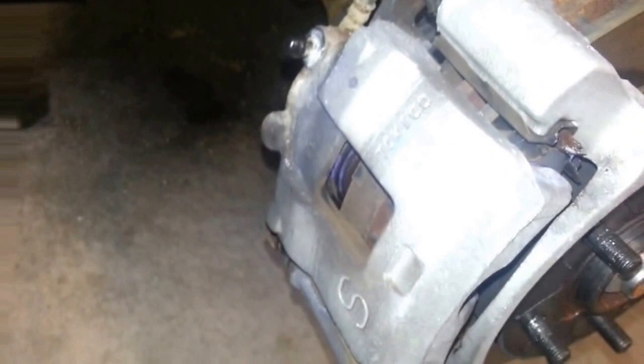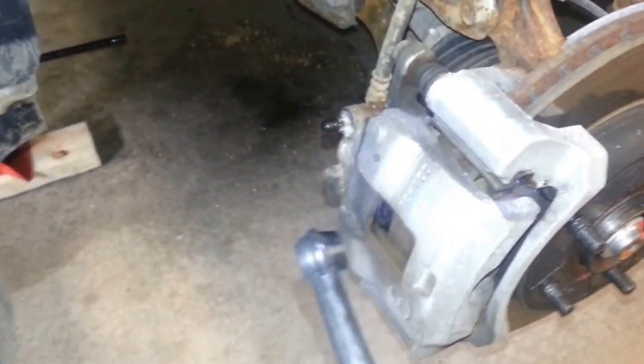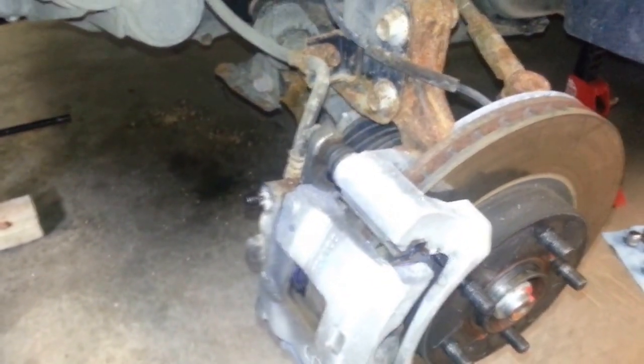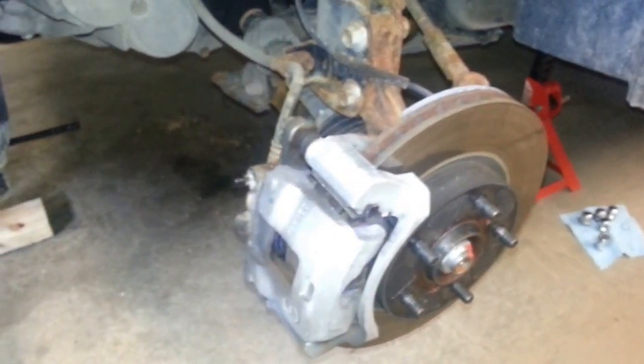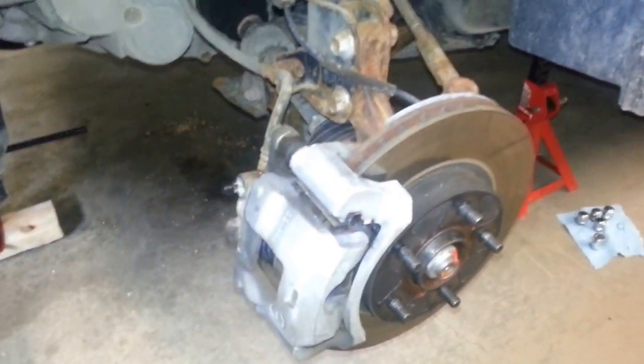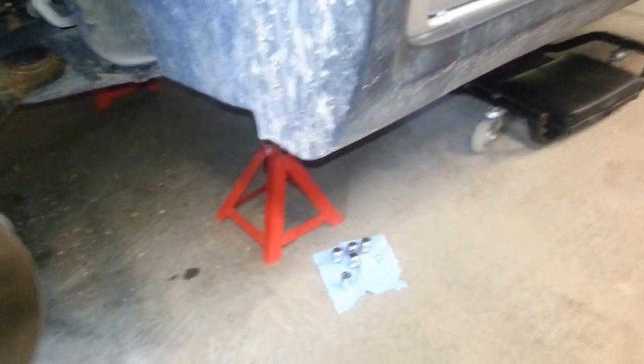Okay, so brake fluid flush is done and clutch fluid flush is done. Like I mentioned, I'd show it when bleeding the system, but I didn't show that. I'm trying to get this done here. However, I'm using a pressure bleeder. So basically it's just hooking it up, loosening the fitting, and bleeding the system. There are lots of videos on how to bleed or flush the system. In the Suzuki service manual, it says do the right rear, so passenger rear first, then the driver's side front, so left front, then the left rear, and then the right front. So that's the order. I didn't bother showing that.